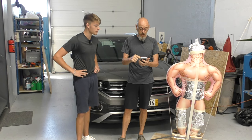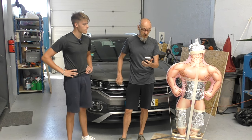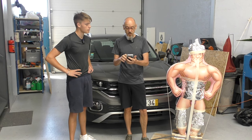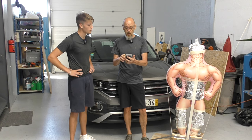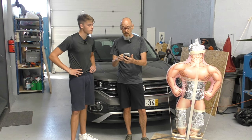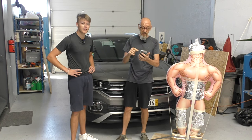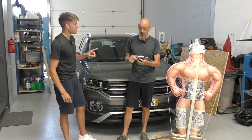Let me tell you what he tells us we should do. In essence, the emergency electronic braking is designed to operate only in the most specific of circumstances. It is not designed to stop for a bin bag or a large piece of cardboard blowing into the road. It is looking for the precise shape and dynamic movement of a person running or walking into the road. This is why a simulated stationary figure did not trigger it.